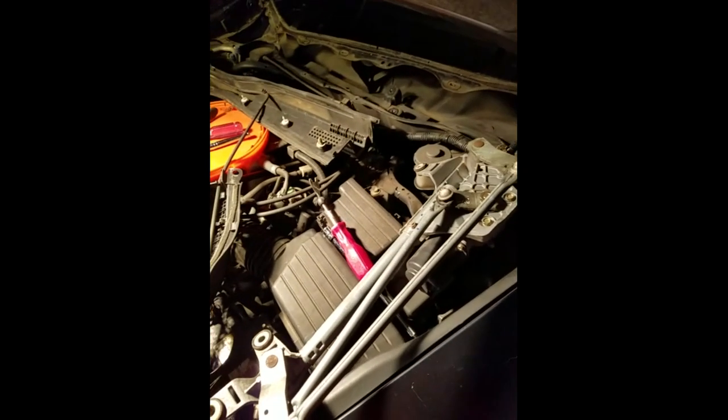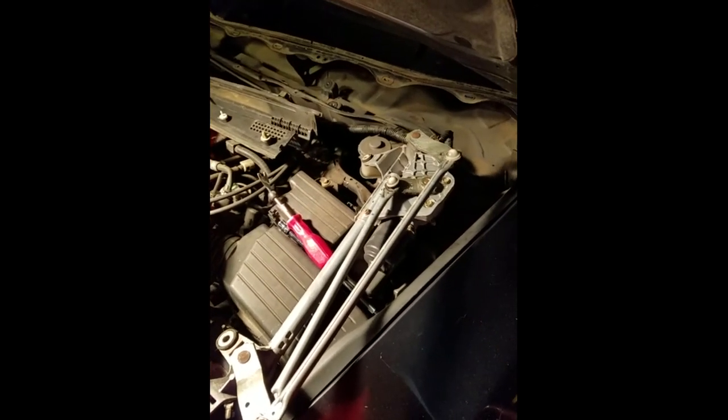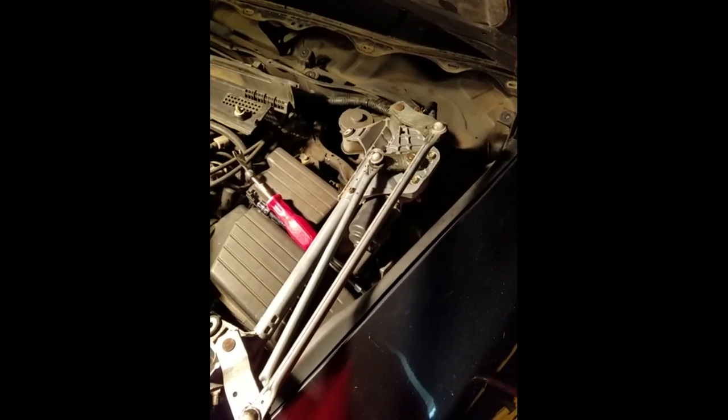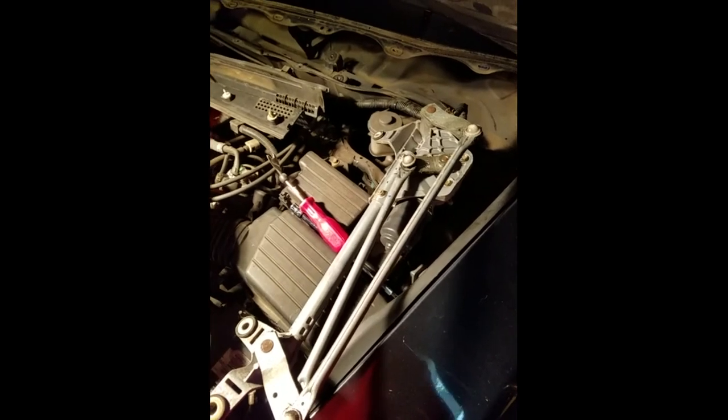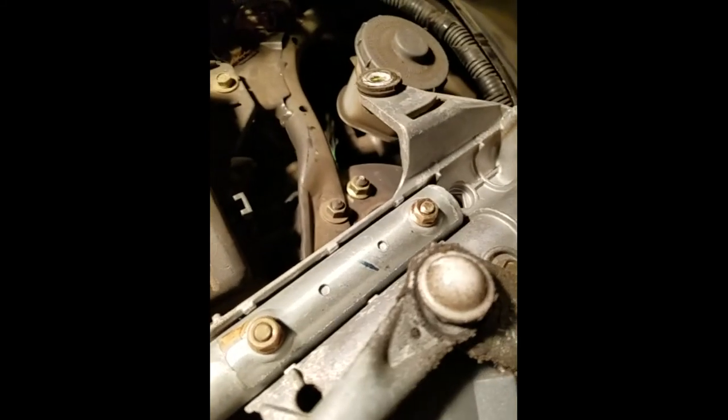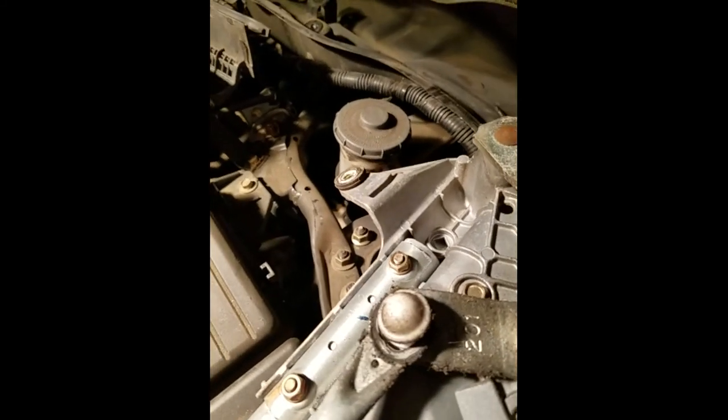At the outset I mentioned the common problem with these older Hondas: if you wear out a bushing, the linkage becomes damaged, the motor doesn't work right, or the bushings are gone, it just causes a lot of racket — they're flying off the windshield frame. If I'd been a better mechanic I might have replaced just a specific part, but you can see this arm is so worn. That's probably the culprit for all the play — just years of friction wearing that baby down.